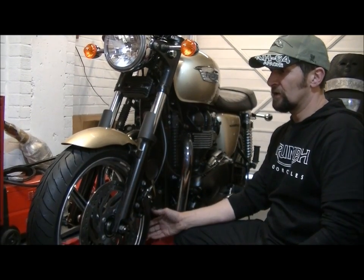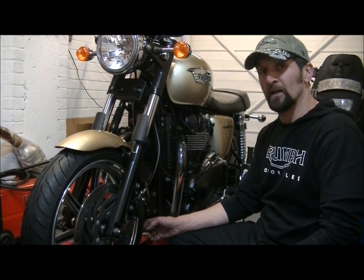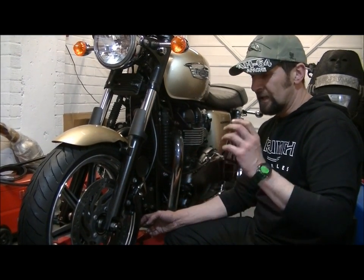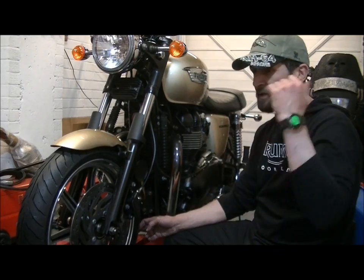If you just go on the internet, look up Caliper Bonneville, torque settings, brake calipers, it just comes up. Everybody's loaded this stuff. It's the wonders of the internet these days. You don't even need a manual anymore. So you can look them up. It's sort of 28, 64, 20 on these and that, and just make sure you do them correctly and get yourself a decent torque wrench and make sure that it's calibrated. If you get a good one, it will be from the packet, and when it's 3, 4, 5 years old, chuck it out and get a new one.